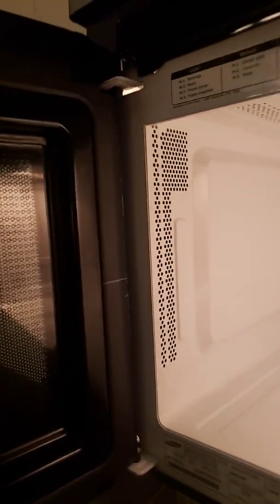Now the other issue was the door moved up and down. The repairman who came out to fix my Samsung refrigerator told me this microwave is out of warranty and it's cheaper just to replace it. So I started looking at it very closely. I have kids in the house and when they open the microwave they have a tendency to pull down on the handle. Over a period of time they slowly bent the hinges — both hinges were bent down — and this gave the door a lot of play.